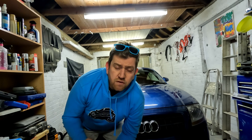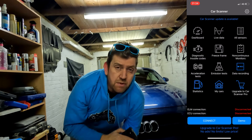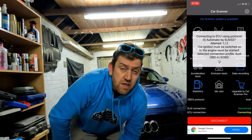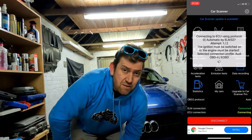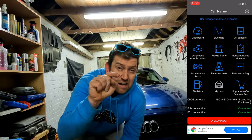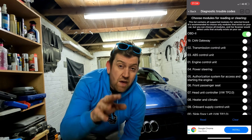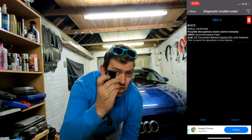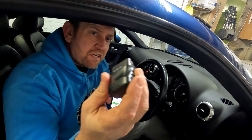The app I use is called Car Scanner — I'll give you a quick look at it. It is free but there is also a paid version. With the free version you can access all the error codes from the OBD2 check and also reset them. The great thing about Car Scanner is you can click on codes individually and it will take you to a website telling you exactly what that code means and how to fix it. I currently have two errors on the 3.2 that I know have come up using this reader.